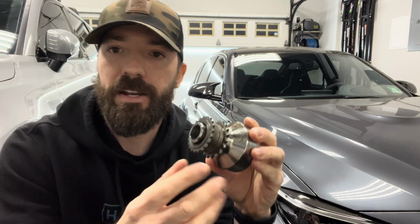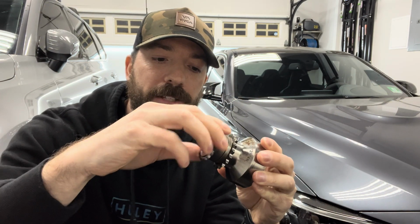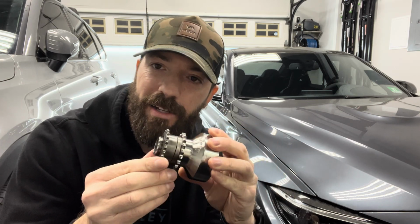Now, the end-all be-all fix is actually replacing your stock crank hub with an aftermarket crank hub. There's a lot of different brands, a lot of different options that you can personally go with, but honestly, I personally think the best ones to go with are a single piece, one that's keyed, or a 2 or 4 pinned option. Personally, I went with the Gintani one, which is a single piece crank hub with a keyed option. Basically, on this side of the crank hub, there is a little notch here. You actually drill into the area where this goes and it locks it into place.